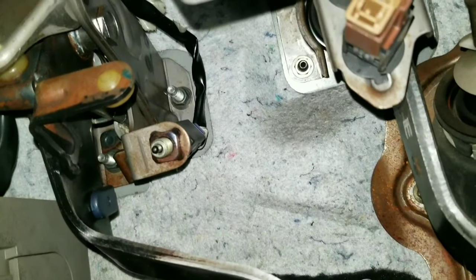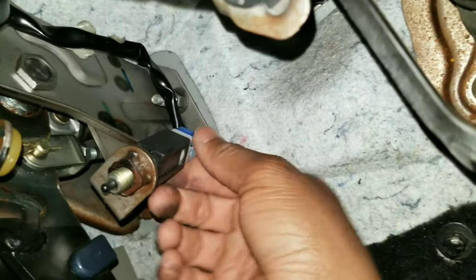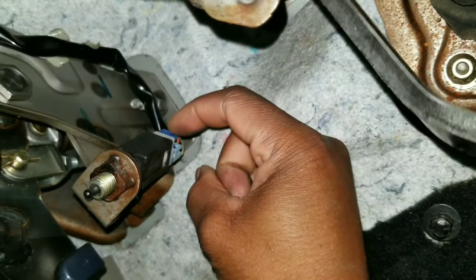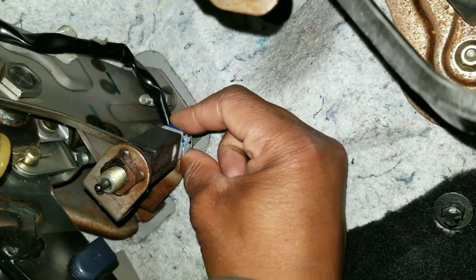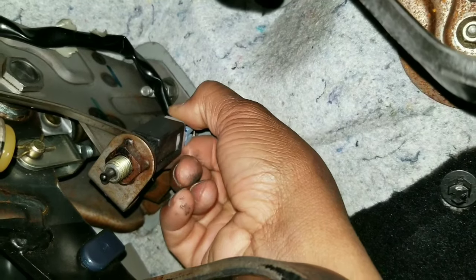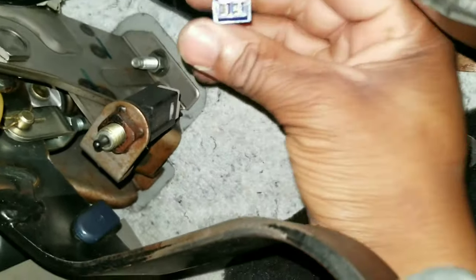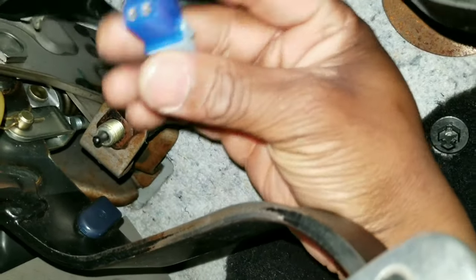Let me get this sensor and plug and show you what I'm gonna do. I just put it back in but I wanted to make sure how to disconnect it. I wasn't sure if this whole piece comes out with the white end included with the blue part. Come to find out, the white piece stays in and just the blue piece comes out. So what you do is squeeze this blue part right here, squeeze and pull, and you see the connector come out. The white piece stayed in there — now I got the connector out and I'm gonna show you what to do with it.